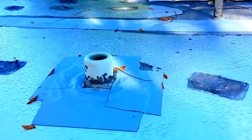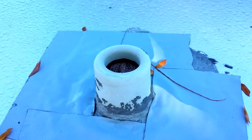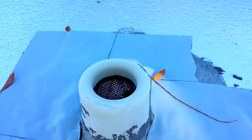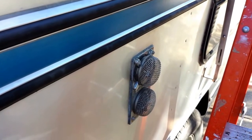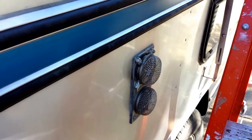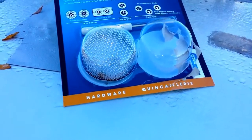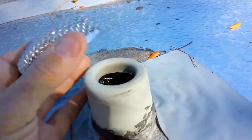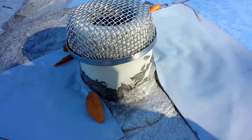As I've been working on the roof taping it down, I've come upon yet another problem. On the intakes for the furnace, there's a screen that's become worn. So what I'm going to do is take the kind of caps you use on the exhaust of a furnace and install a pair on the top of the trailer. These are readily available at any supply store — I got these two at Camping World. They fit on the top very nicely, and I'll just put them on, take a couple of stainless steel screws, tighten it down through the pipe, and that job will be done.